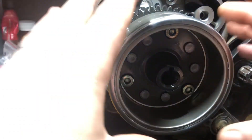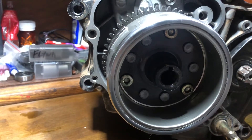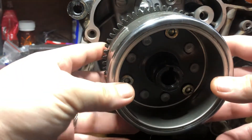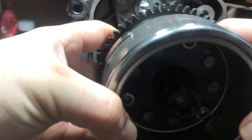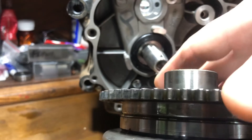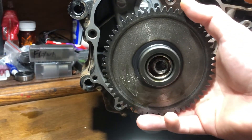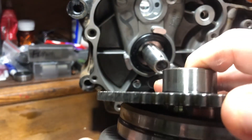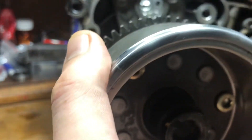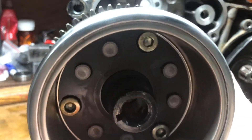So you put your motor in time, get your stator cover off exposing your flywheel. You've got your 14 millimeter bolt out — take your flywheel puller, screw it in, and get your flywheel off. On the back side you have your starter gear, part of the reduction setup. If you go to pull your flywheel off and the starter gear stays on the crank, it's not a big deal — it just simply snaps back into place. And this is why we rotate the motor counterclockwise: you can see it'll spin this way but will not spin clockwise.